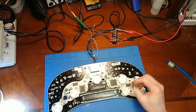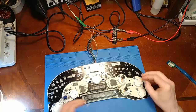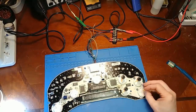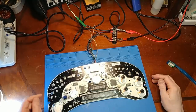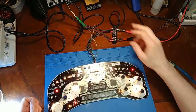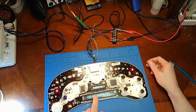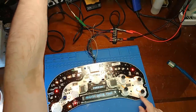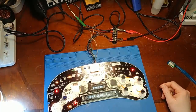I'll throw some needles on these guys to see if we get any movement out of them. That's usually the first thing people notice when you lose serial data bus communication: these four gauges over here don't work. This won't either, but let's power it up. Let's see what happens. That's good. Engine overheated. That means it's talking. See, now I can move these needles over here. All right, so that's all it was. It's just a short.